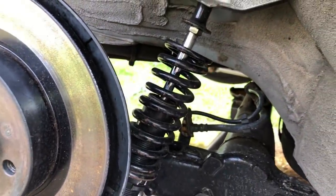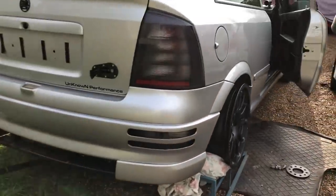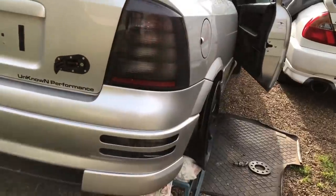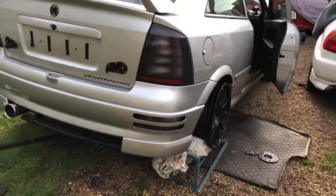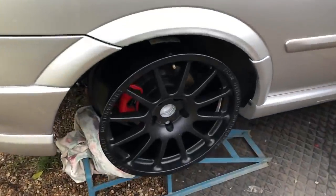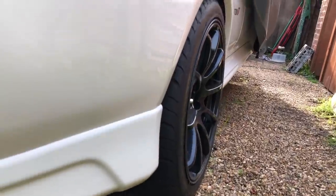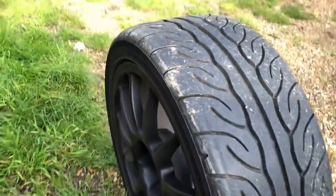While the wheel was off I couldn't help fitting the 9J deep dish wheel on the back. It's a really aggressive offset — ET23 9J, which is mad — but I'm going to pull the arch out a little bit and with a 235 tire they should go in no problem. You can see how wide the rear is going to look with them on. The 9J evo wheels have a 235 Federal tire with a flat or slightly stretched wall to clear the arch. These have more of a dish similar to old BMWs, as opposed to the standard Team D 7.5J and 8J wheels that sit flush.